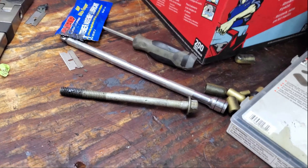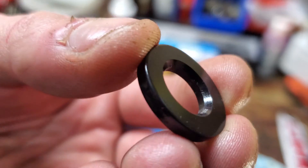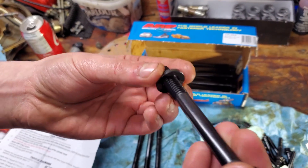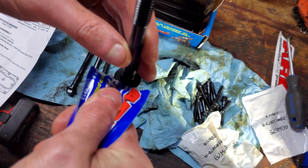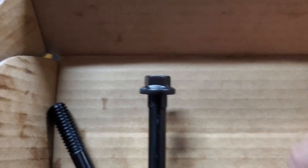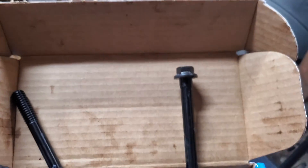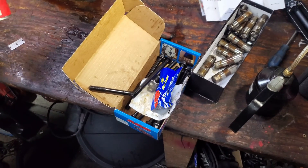That is studs shown. Next we'll hop onto the bolts on the LS. So, bolts — we're installing ARP head bolts. We went with bolts because we're not boosting. There's a chamfer to the washer that goes towards the head of the bolt. Grease goes between the washer and bolt head, not on the bottom. Clarifying on the bolts: the chamfered edge goes to the top towards the head. If incorrectly installed, you will pop the head off of your bolt. Each one will come with torque specs included.